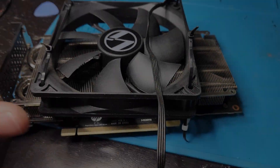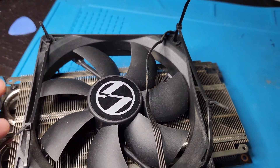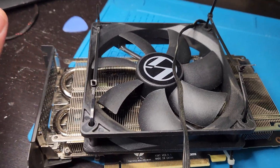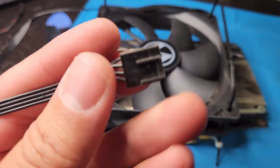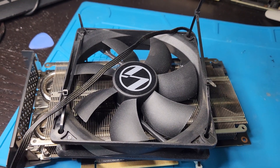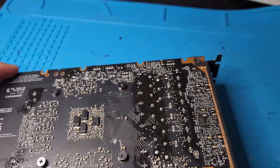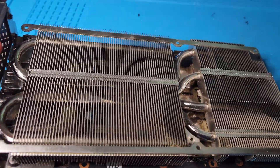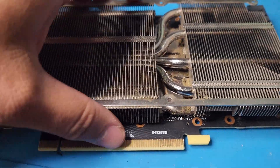On the bench, I'm going to do two things with this GPU: repaste it and try to put two fans on it — maybe two smaller ones — and attempt to wire up a fan shroud like I did with a 1080 Ti and a 6800 XT I've since sold. The card has clearly been running at around 80 degrees for way longer than it should have. I'm taking off the heat sink; you can even see oil leaking with the dust.